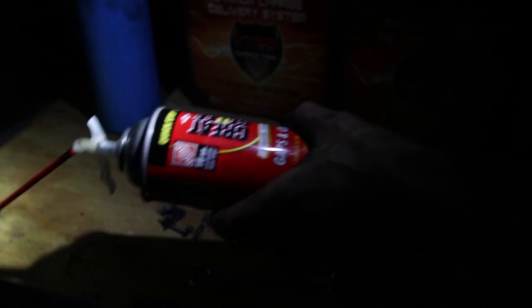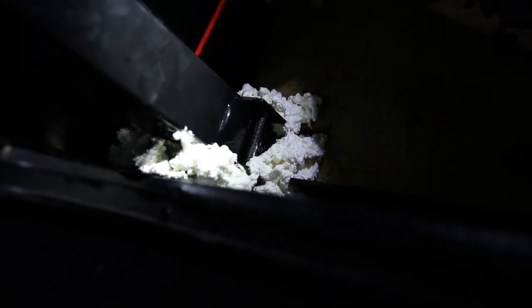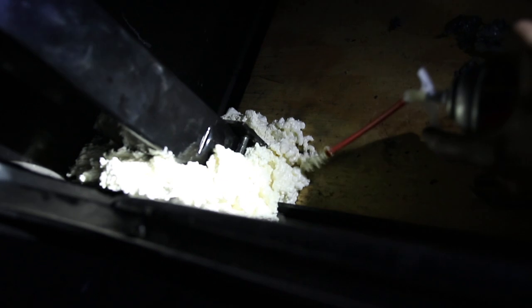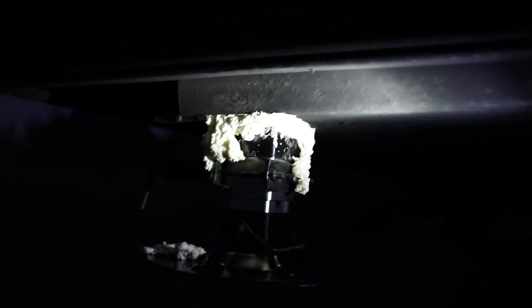The last thing to do is seal up where we scraped away the old sealant. This is Great Stuff for gaps and cracks — an insulating foam sealant. We're sealing this because the truck blows black diesel smoke and we don't want any soot coming up into the storage compartment. Apply it liberally; it will expand and come out the bottom. Check underneath to confirm it's coming out, add a bit more to ensure a good tight seal. Once it dries, cut away the excess with a razor blade.